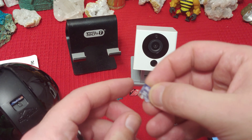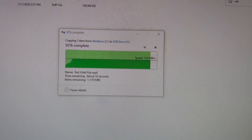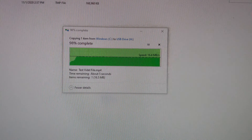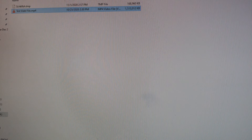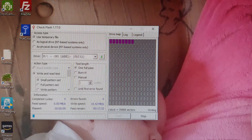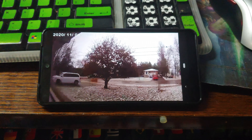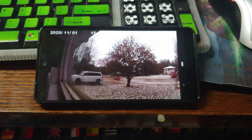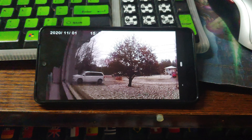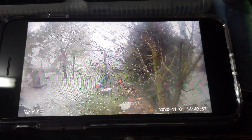In the meantime, let's take the last one and throw it at a stress test, shall we? We're transferring directly to this card at about 15 to 16 megabytes a second. The minimum on this card is 10, so that's what we get directly writing to it. Next up, I'm going to run a full scan on this card and see how healthy she is. Here's my security camera up front. That D-Link is a pan-tilt-zoom. Every time it tilts and pans, it records, so we're going to get a lot of read-write tests out of this. Recording in the backyard — this is a straight recording. We should give this a thorough test.